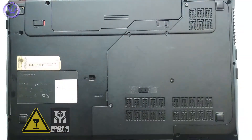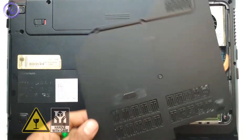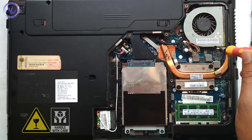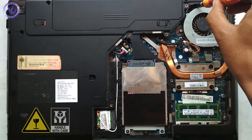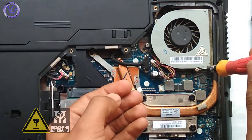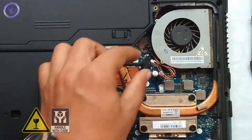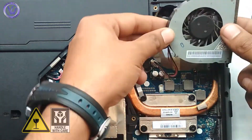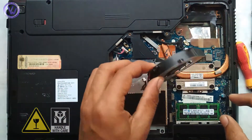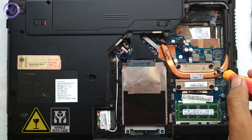The laptop has an embedded AMD Radeon 6300M series graphics card. Now take out the fan by loosening three screws. Gently take out the fan connector to the motherboard and remove the fan. To take out the heat sinker, we have to loosen five screws — four bigger ones and one smaller one — which will take the heat sinker off.